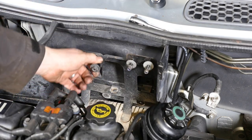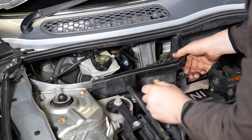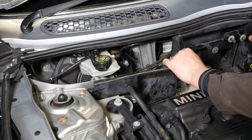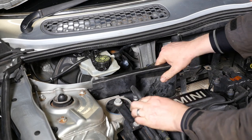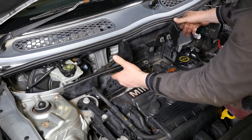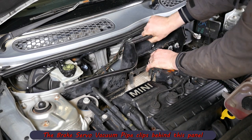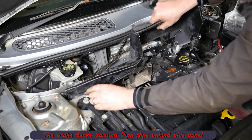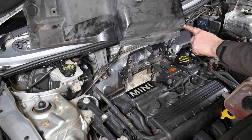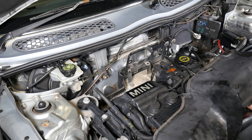The next weather shield and plastic part need to come off — there is a brake servo pipe behind clipped on two clips, so be careful not to pull the pipe with the panel. Here it comes, and you can see the brake servo pipe behind. There's one clip there and one there, with the brake servo pipe going to the engine.